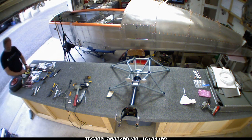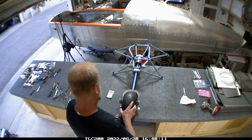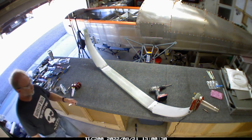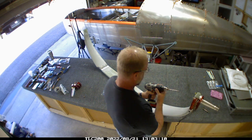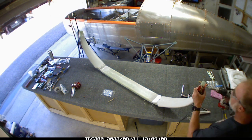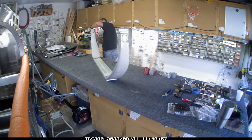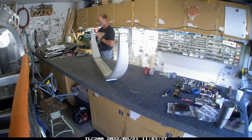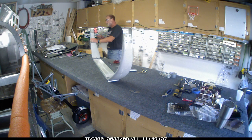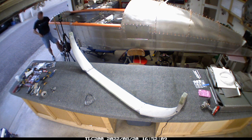I don't think I'll have to take that yoke off again, but I know the engine mount will come on and off probably at least a couple more times as I work to get the engine actually on. I do have the engine at this point, so the only parts I'm waiting on are the interior — it's becoming more and more all on me to see this thing through. Those are not the final bolts — those were just some bolts I got at the hardware store while I was waiting on the aviation-grade bolts, so this is just a temporary setup. When I do finally set the actual bolts, they'll have a castle nut lock on them as well to keep them from rotating off.